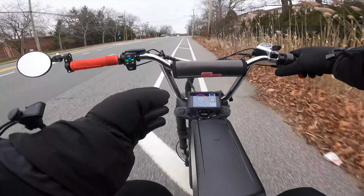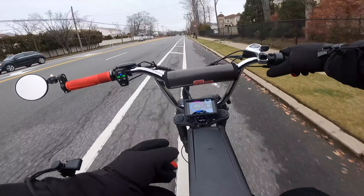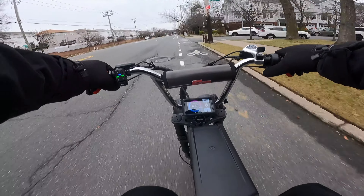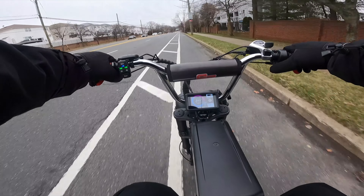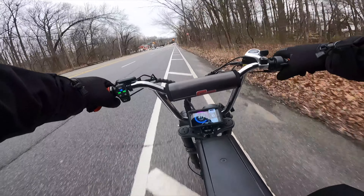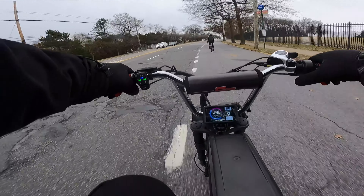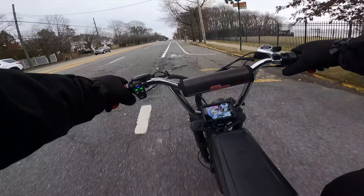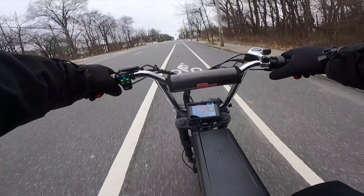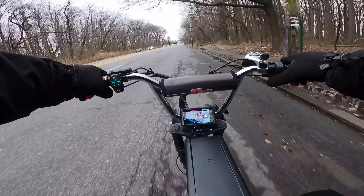So we're back at it. Pay attention — it's voltage sag. At a standstill I was looking at around 50 volts, but at full throttle moving at about 34 miles an hour, we dropped down to about 44.4 volts. The battery voltage is lit up in red on the display. I'm still on Highland Boulevard and I've dropped down to about 42 volts now. The battery display has the battery voltage extremely low. I'm curious as to how much range I have left and what the cutoff point on the controller is set at.